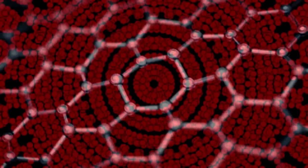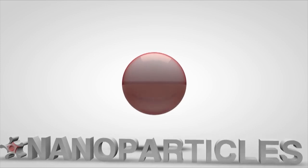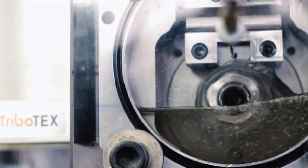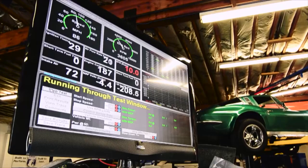Many people ask, are nanoparticles going to be stuck in the filter? In a typical filter, pores are about half the thickness of a hair — about 20 microns, when hair is about 50 microns — and the nanoparticles are usually less than one micron. So how does it work for an engine that has some wear? These unique nanoparticles have two different sides. One side is sticky and another is slippery. The sticky side attaches to a surface and the slippery side forms a film. When they build particle by particle, they form a much thicker coating than any lubricant — you can actually see it by the naked eye. That coating compensates for the wear accumulated over years and years of running the vehicle.